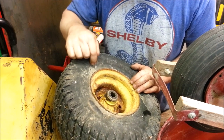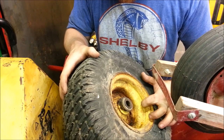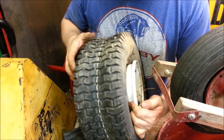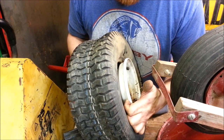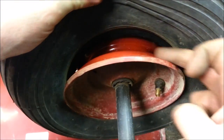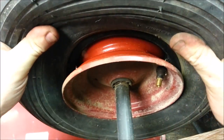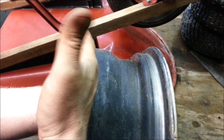Why? Because this is a tire and rim combo that is designed for tubeless. You'll notice right here this little indent that locks the bead on. You'll notice on this one — no indent. The rim can just slide right off. They deem this rim a tube-or-tubeless rim, but this is clearly a tube rim. With the wheelbarrow tire, you can see they're all this way — they just slope straight in. They don't even have a nice flat shoulder. Most of them don't. So this tire just has to lose a little bit of air pressure and it pops right in.